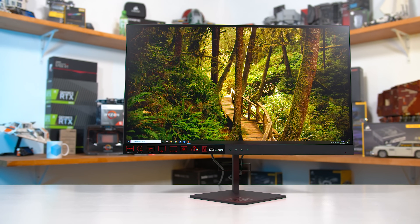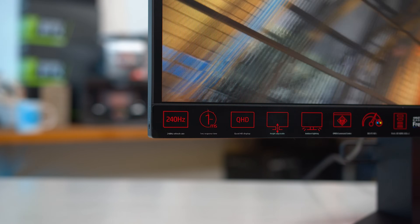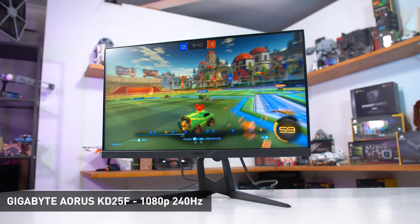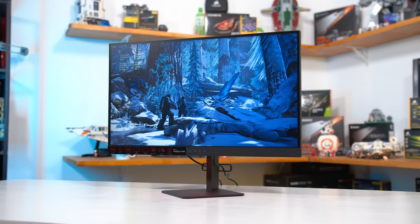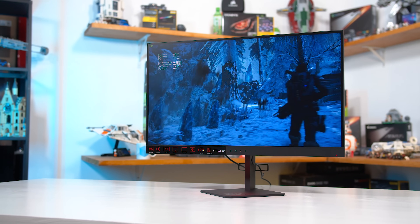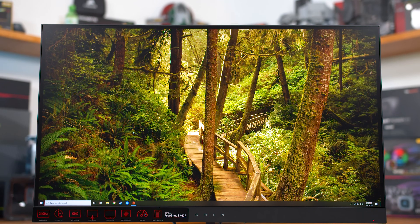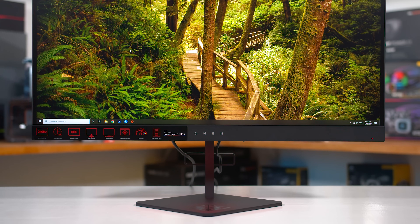The thing that makes this monitor special is its refresh rate. We're looking at a 1440p display — the standard 2560x1440 — but it pushes up to 240Hz for the first time. We've had 240Hz available with 1080p monitors for some time now, but 1440p hasn't been able to step up to this super high refresh rate until now with these modern panels. It won't be a surprise that 1440p at 240Hz requires a TN panel, and TN is now hitting 240Hz at higher resolutions.